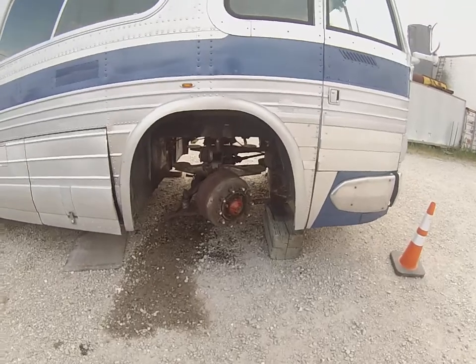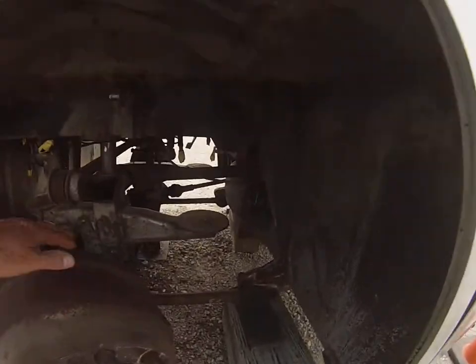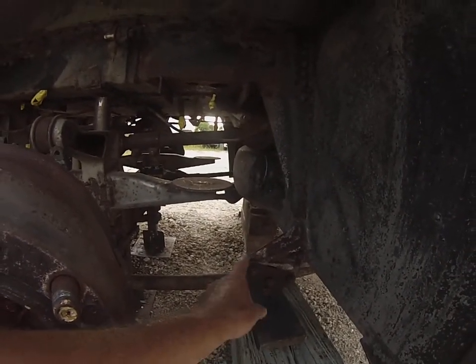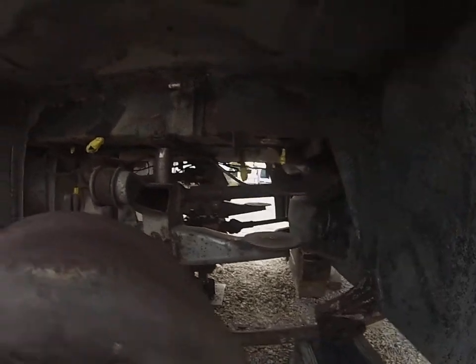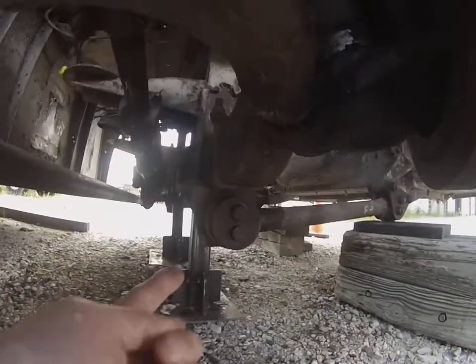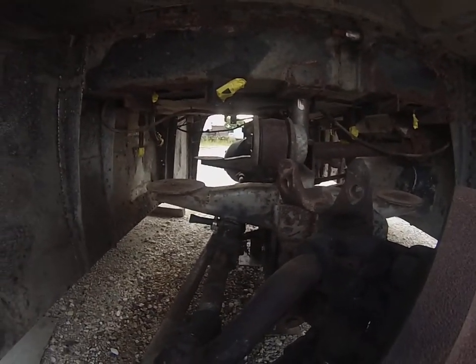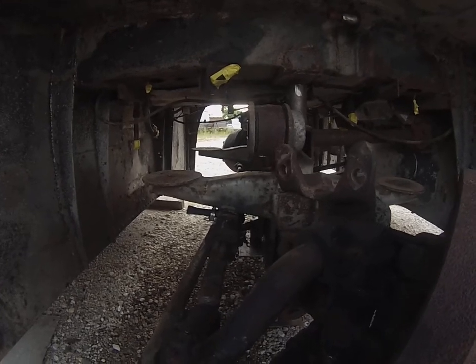You actually just need two size wrenches. The nuts are 1 1/8 inches, and the bolt heads are 1 inch. Any of the bolts, like these here, 1 1/8 inches. These guys down here, 1 1/8 inches. So that's really all you need for the removal. I used a 3/4 inch impact and it took them off.